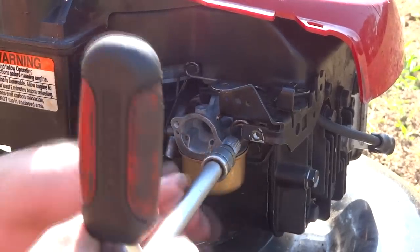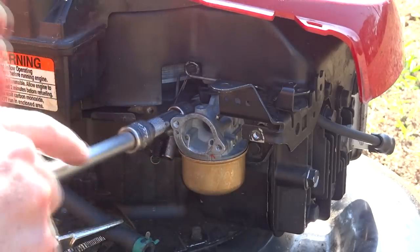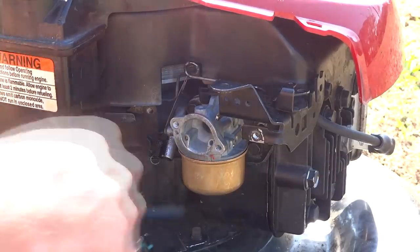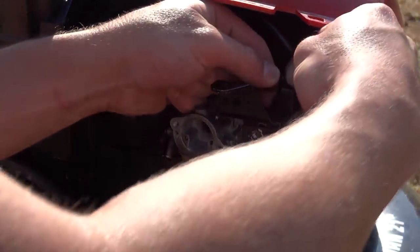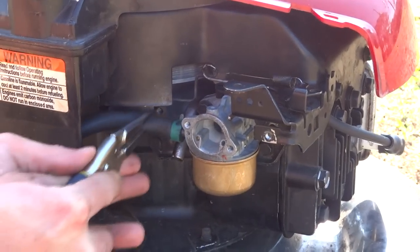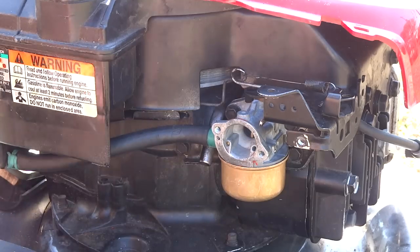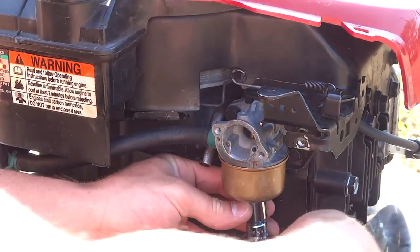Always make sure that that rubber o-ring is thick enough behind the carburetor. If it's not, you won't get proper compression or proper air flow through the carburetor. Now we're able to put this spring back on — just grab the spring and hook it back on where it came from. Now we're going to go ahead and put our hose back on. I usually just leave the clamps on there and give them a good push. Now you can let go, squeeze it back out, make sure it has nice flow.